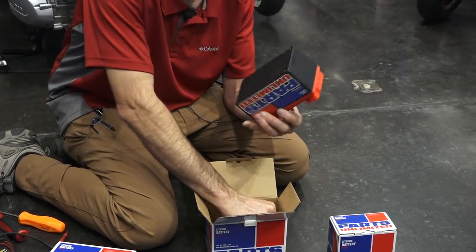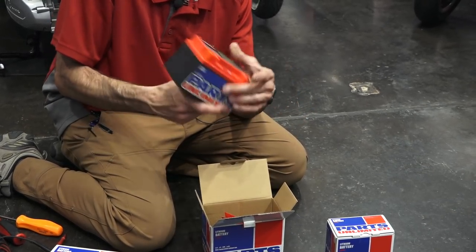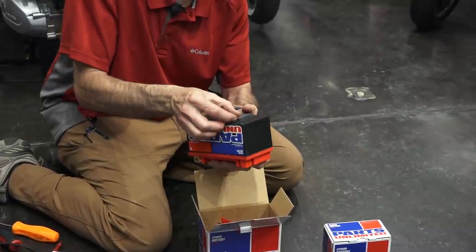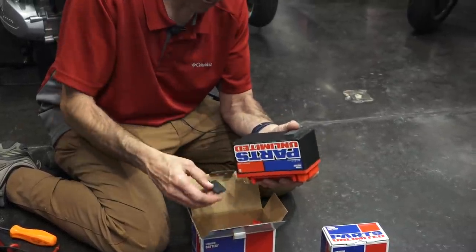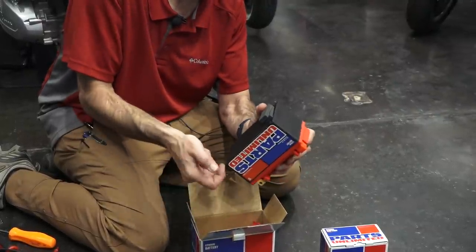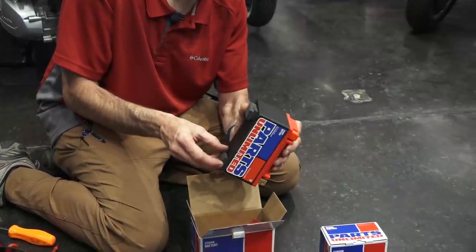The difference with this battery is it has lower cranking amps and pretty much directly replaces the smaller size battery. If you're replacing a 9 amp battery, it includes a set of foam spacers — you put a pair of these on both sides and it will fit into the standard YTX9BS battery tray.